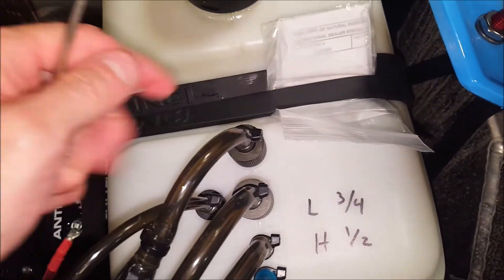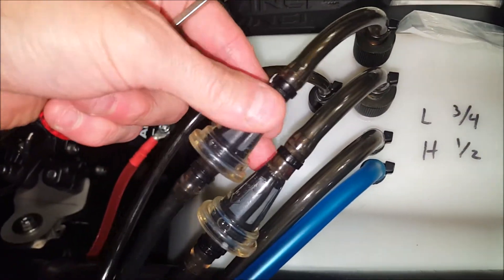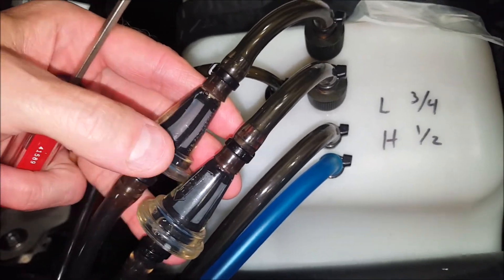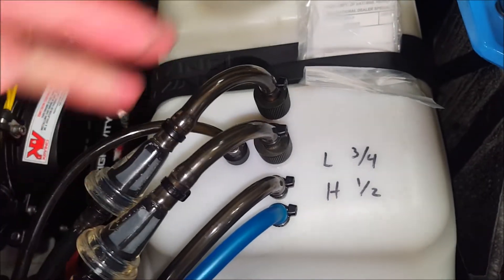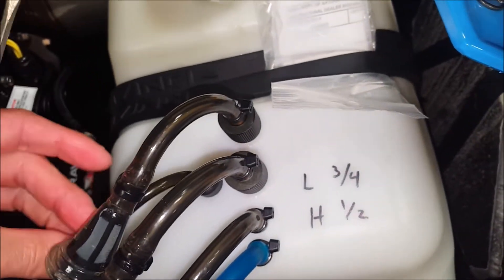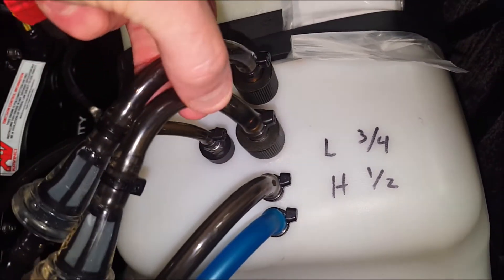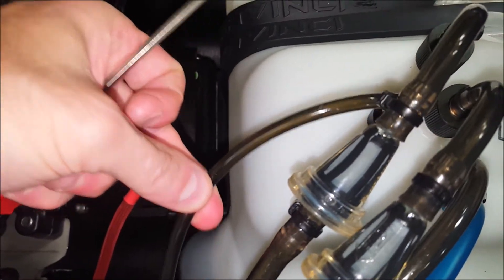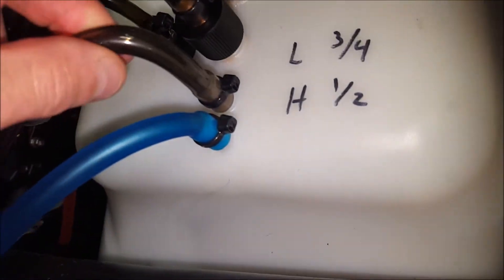This is one of the pickup tubes to the carburetor with a filter in it, and this is the second one here. You want to check these over to make sure they don't have cracks in them and aren't sucking air down through the lines. We have a whole other video on how to pressurize the fuel system. Today I'm just going over the line routing itself. These two are your inlet lines, this little one right back here is your feed to your primer system, and then we have a return line right here.